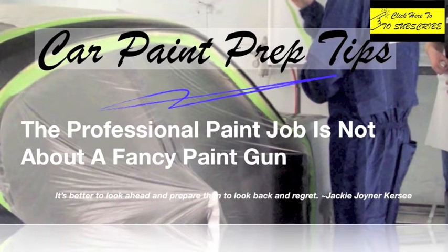So you're going to wash your car really good, and then you want to do another step to assure all wax and grease contaminants are off, and that's to wipe the area that you're going to be painting with wax and grease remover. You put the wax and grease remover on there and wipe it off, and this just assures that all traces of contaminants are removed from the paint surface.